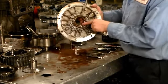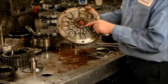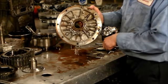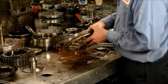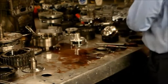And also, you see this is that seal. Remember the video on the Ford front seals? This is the seal that's no good. This is the gray seal. And this is how it comes through from Ford, but those seals are no good. All right, so this pump is shot. It's going to have to be changed.